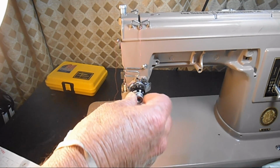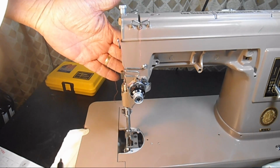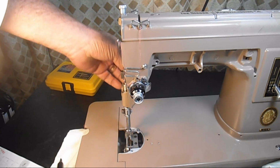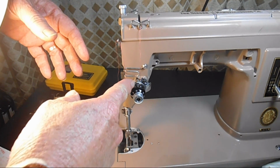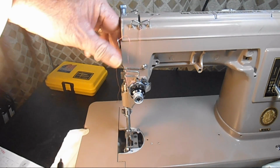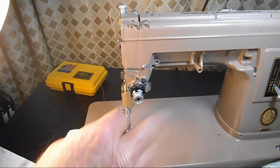But that's basically zeroing it out, so when the pressure bar lever is down, letting the spring put the tension on, and you're pulling the thread through there, you can tell, oh yeah, there's some drag on the thread. I can tell something's dragging, you know. I'm setting it at 0 and something is dragging it there. Okay.